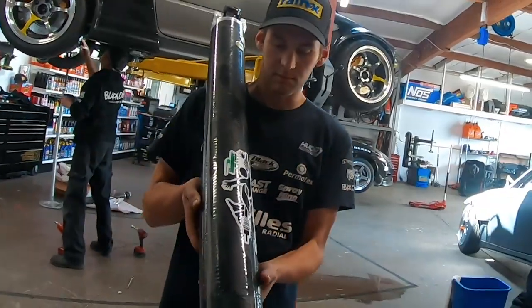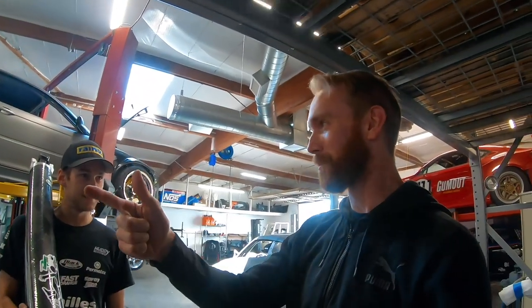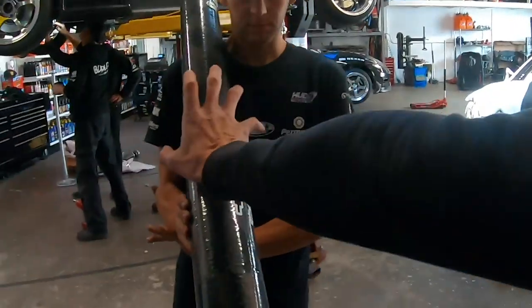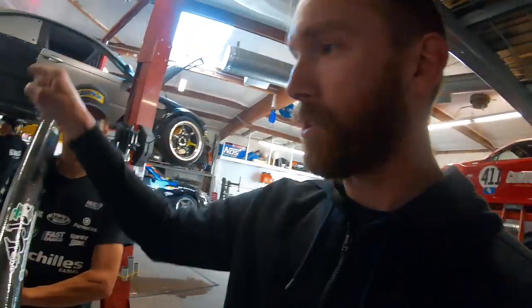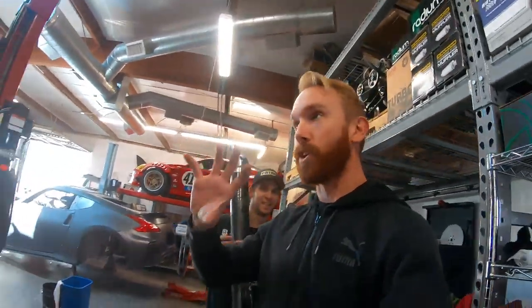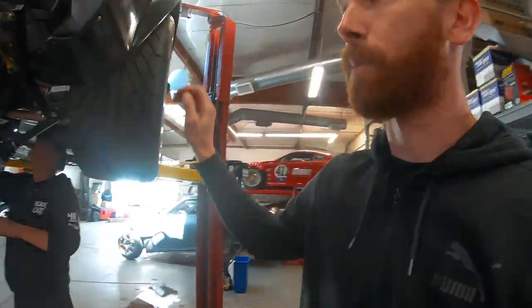2010, I wanna say. And we actually ran these in the car through practice from Thursday through Friday morning, just seeing if we could break them, because these actually get somewhere in like the 20 to almost 30 degrees of torsion from the transmission to the actual diff itself. And what that does is gives us a little bit of cushion as we're kicking the clutch and dropping the handbrake and everything else, getting the tires spun back up again.